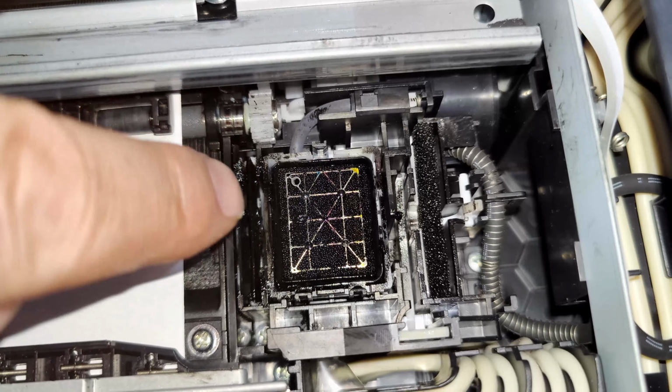And what happens is it sits on the pad. There's a pad there, it sits on it, and when it goes across to go to print, whatever it's going to print, it drags a bit of ink. See that? And it just drags it right across and just makes a right old mess. So if you want to give that a good clean every now and again, or when you actually get a bit of smearing, this hopefully will help you resolve any of your issues.